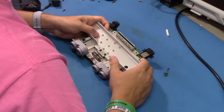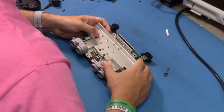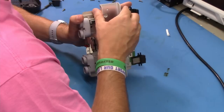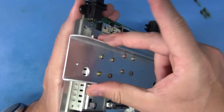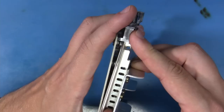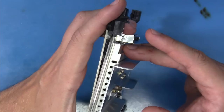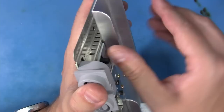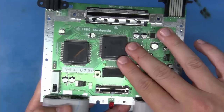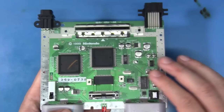We'll take our two screws and put them over here. Now this is where things start getting a little crazy, and this is where you have to start paying attention. When you remove this assembly, I recommend that you hold the board flat with the power port facing up. Take your index finger, plant it on the top of the power port, and grab the heat sink with your middle finger and your thumb. Start very carefully only separating in this corner — one, two, three — nice and easy. Only this corner. When you have this corner worked off, come down here to the player one port and simply rotate your thumb out just like this. And you have totally liberated the heat shield and the heat sinks from the main board.